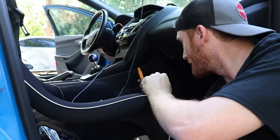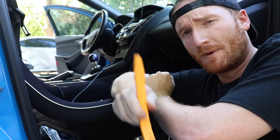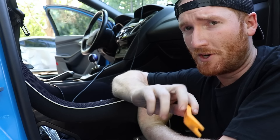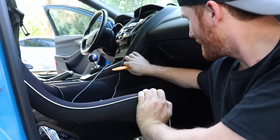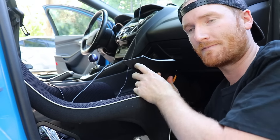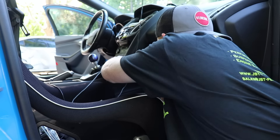So the first panel you've got to remove is actually up here. I'm just going to use — you can buy this off Amazon, it does not come with a kit — this is a plastic panel removal tool. You can use a screwdriver but you are going to scratch the living hell out of your car, so buy one of these. Down, up, and that's actually really easy. It just pops. I'm going to go underneath, pop it out, slide it out. This one's now out of the car.